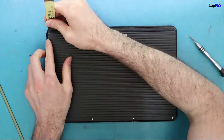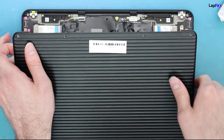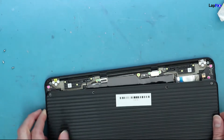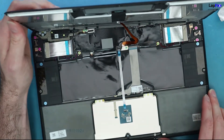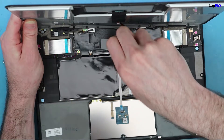There are two rubber feet to pry up, then screws are exposed. The scary part is when you remove the back you don't want to just yank it off because there's a cable in between. If you don't remove that cable the right way, you'll rip it and have a real bad time finding a replacement.